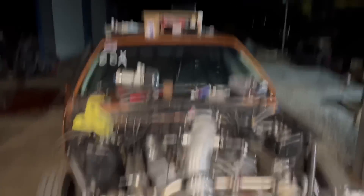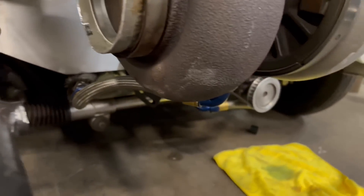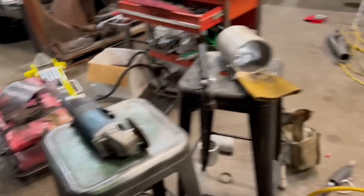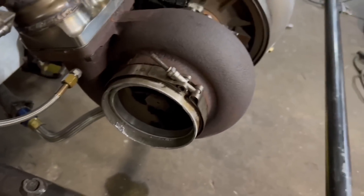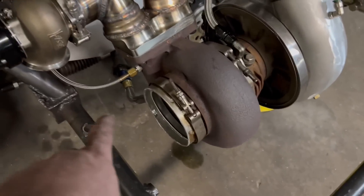It is now dark outside — we've been over here for eight hours today. The drain line is done, it's got good fall working like it should. I might have to loosen that up so it goes downhill the whole time. The feed line works — it barely fits but it does fit. We started cannibalizing Randy's hot side: we got a bend here, his horn that took a smacking but it's okay. We got his flange on the turbo — I had to cut it because it was dented badly where it crashed. Now I'm fixing to grab the front end and decide if we'll just come straight out with a little bullhorn over here and go out the fender.